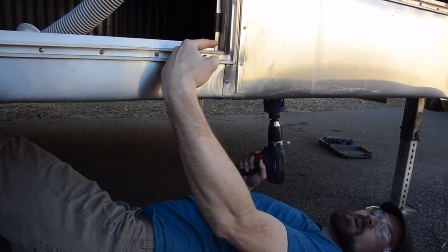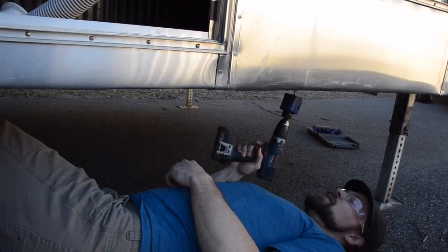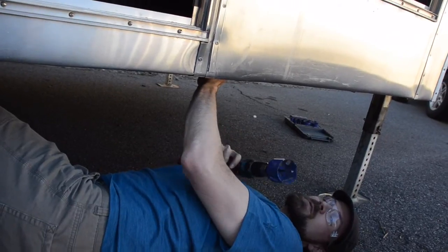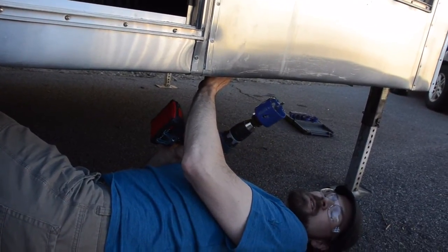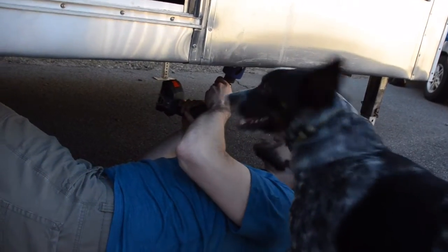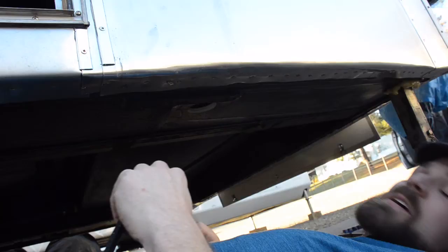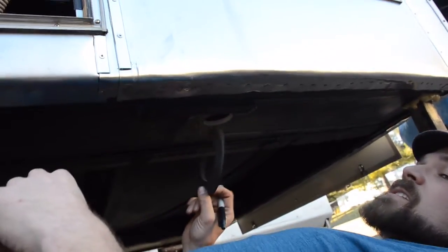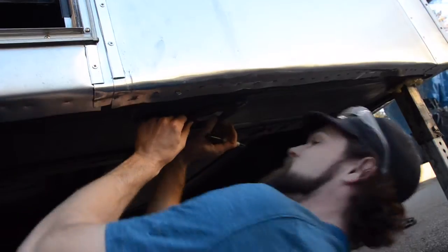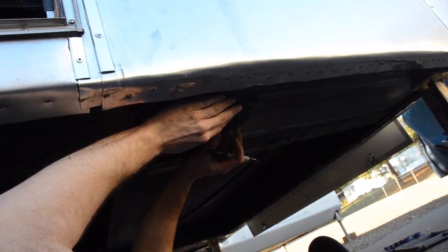The fan shroud is going to go inside this compartment pointing straight down. There's no clearance in there to use a drill, so I'm going to drill from the underside. There are some steel supports I want to make sure I miss, so I can see where they are from underneath and locate my hole saw accordingly. The instructions say two and a quarter inches, but I've got a two-and-a-half-inch saw — that's what my set has. We've got our hole now, two and a half inches. This is the gasket for the fan shroud — it needs to go on top. It's hard to locate the drill holes from inside because of the tight space, so I'll use the gasket as a template underneath and drill pilot holes up from below.